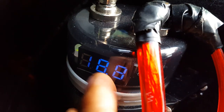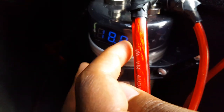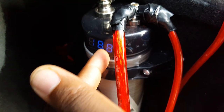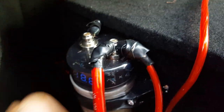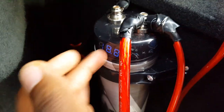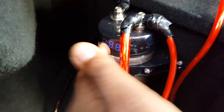The voltage shows here on the side when the bass kicks in. Some capacitors don't show anything on the screen until the bass hits hard, and then it shows the voltage on the side. So if you get a capacitor and it doesn't show anything on the screen with the music on, don't get worried — it might still work. Turn the bass up and see if the light turns on. Some stay on all the time, but mine stays blank until the bass hits hard.